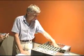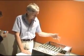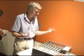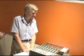And again, we can support tons of I/O. So each Express slot can support 2 fiber channel ports at 4 gigabit, so we can actually support 12 4-gigabit fiber channel ports, which is almost 100 gigabits of I/O right out of the box for people that want to go maximum density.